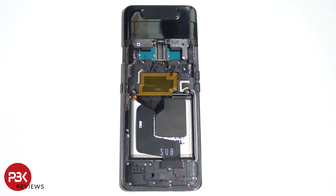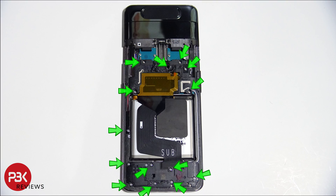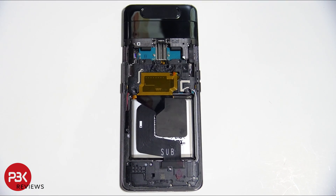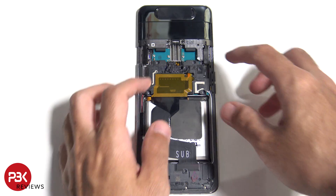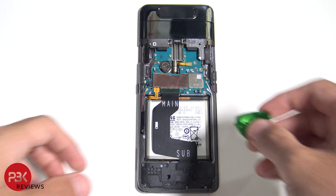Make sure you pull the camera fully up so you can reveal this hidden screw right over here. Then remove the 14 Phillips screws. Let's remove the top cover. Now we're going to disconnect the battery cable.